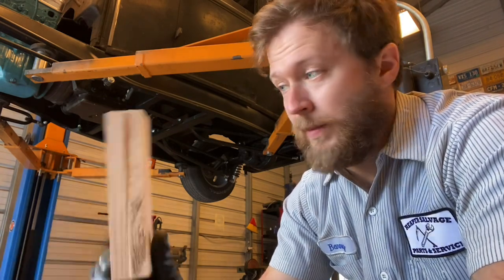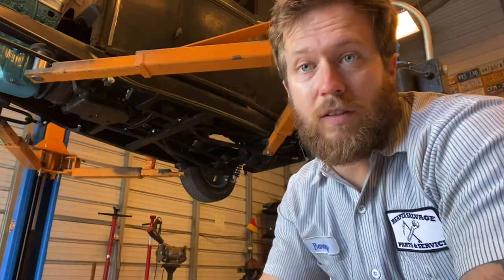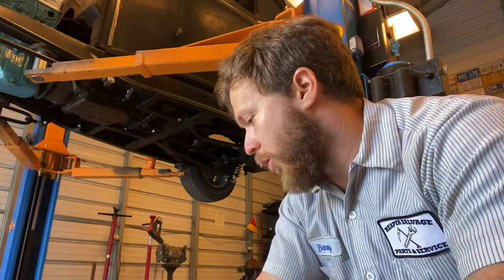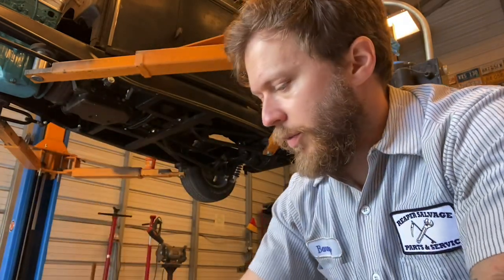But when I put mine together to where it's at, I clamped it down, and that's the clearance between the bottom of the sub rail and the frame. So 3/4 inch. And you get that nice sunken down, sitting over the edge look that you want instead of having those goofy gaps. So I'm gonna set these in there. I'm gonna have to gnarl out for that piece right there that's all boogered up from the last one. But I got to gnarl out for that because that's where a bolt goes.